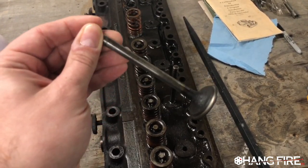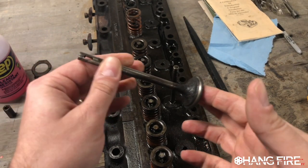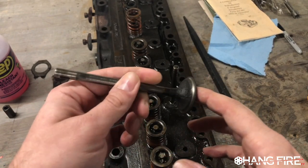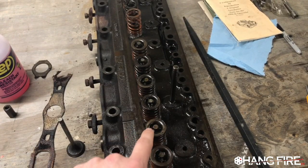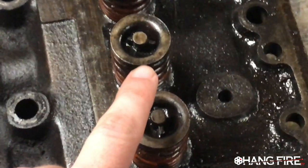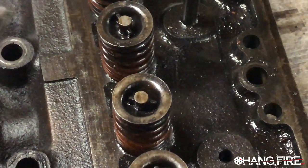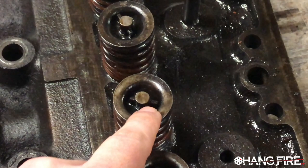We're gonna turn this on the lathe and check the run out. I'm gonna say that what happened here might just be a result of this thing not actually being straight. That maybe this happened before, or maybe this isn't completely straight. So the failure mode here was that there's this hat, and then what we can see down on the inside of here is this pin. There's a cross pin, right? There's a cross pin that goes in that slot. This is sitting like this at the top of the head. That cross pin is sitting there.